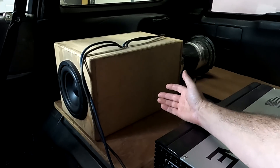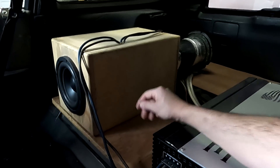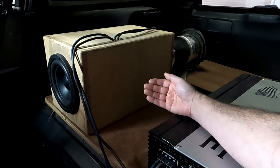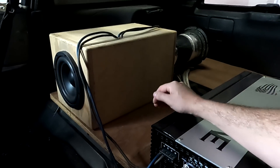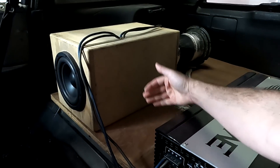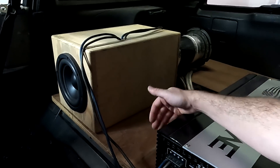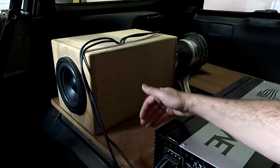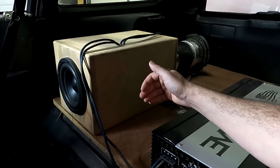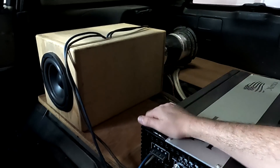I don't know that we could go over 400 — 800 is pretty sure not going to happen in this enclosure. But we'll have some good test points. So we're going to check 100, 200, 400 and see what happens. Does it gain every time? Then we're going to put a second sub in and do the exact same power levels, because then we're only doubling cone area, and that should theoretically gain 3 dB at the same power. From there we will double those power numbers — so 200, 400, 800 — and see what happens there.